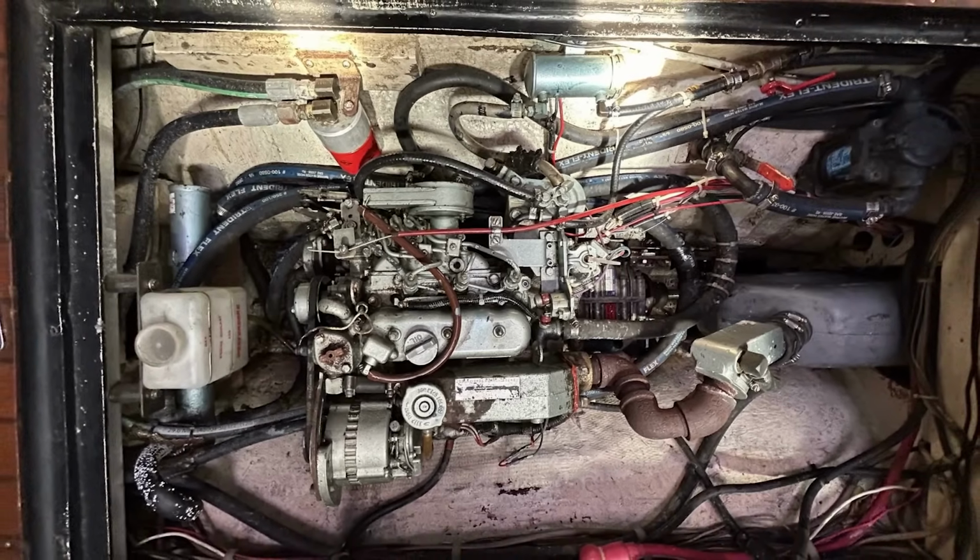before one gives way. I don't know about you guys, but this sailor is going to take a very close look at his engine mounts today, looking for those telltale black rubber dust signs a failing engine mount may start to give off. I also look for that black dust around the accessory belts on the front of the engine. A belt will pile up that black dust as it wears out.